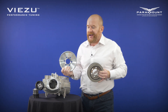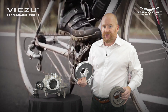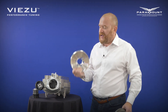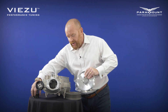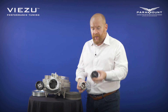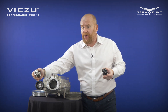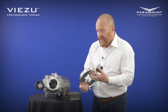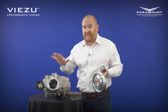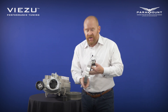So one of the really quick wins for performance is fitting a larger crank pulley — as you can see, this one is considerably larger than the stock pulley. It changes the gear ratio, much like a push bike: a larger front sprocket makes the back wheel go faster. That's exactly what happens here. Another option is this smaller supercharger pulley — it's seven percent smaller than stock, and it has exactly the same effect. A smaller pulley on top makes the supercharger go faster; a larger pulley on the bottom does the same. The magic solution is both combined: bigger crank pulley and smaller supercharger pulley together will take this charger to 17,000 RPM — still safe within the manufacturer's tolerances — delivering up to 22% additional boost pressure over stock.